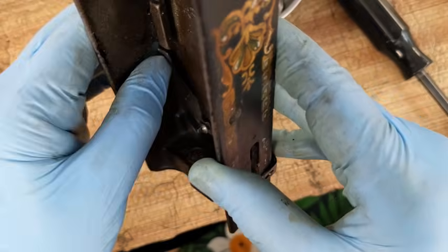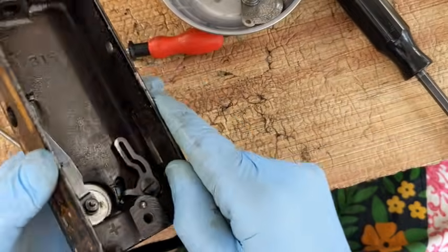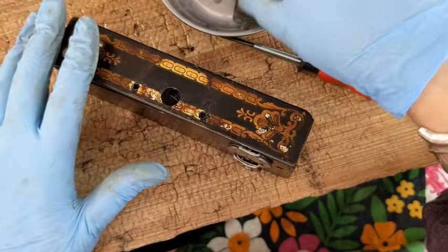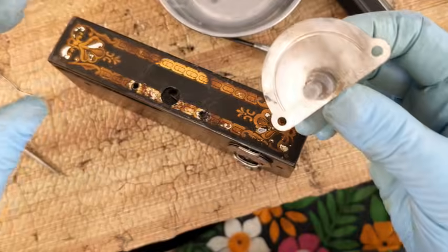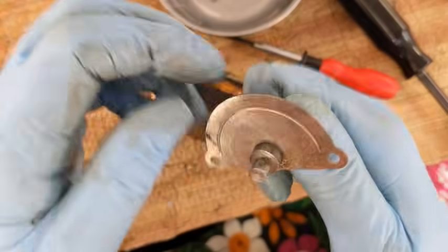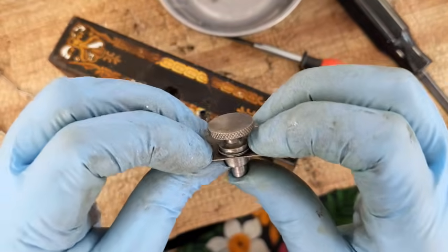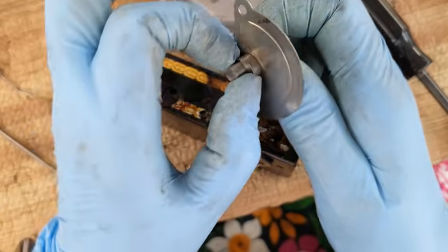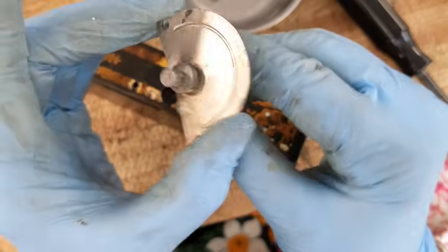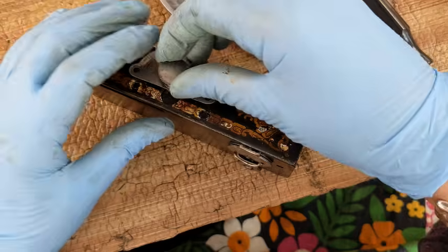and that is correct. So what's going to hold this spring down is the little stitch length indicator, and you can see it's not perfect here. It's clean, but it's not perfect. But you know, as we do, this is still moving pretty stiffly. And I'm thinking that it's just supposed to, because it has to put enough tension. See how that's not symmetrical? I think it just has to stay stiff. So I'm going to go ahead and pop it in.